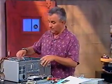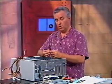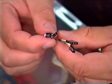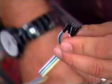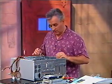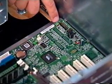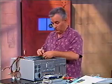My motherboard's in — this is the time when you really do want that manual, because now's the time to connect these fiddly bits. I hate doing this part — you're almost guaranteed to skin a knuckle. These are the reset switch, the power switch, the LEDs — the little lights that indicate hard drive access or when the power is on. These have to be attached to connectors on your motherboard — usually an array of pins in the corner of the motherboard closest to the front of the machine. They may even have silk-screened the pin functions onto the motherboard, but it's easier to find that in the manual.